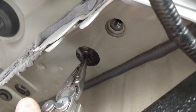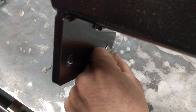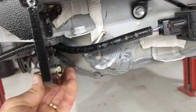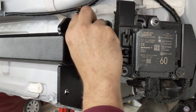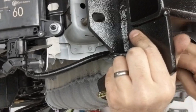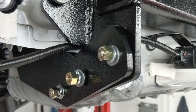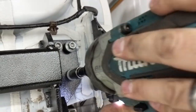Pull out these three thread covers on the frame on the bottom side, then poke the bolt and washer through on the forward-most hole oriented to the outside. Then get a few nuts started — those are the original nuts that came off the bumper — and then put the rest of the bolts and washers on. Just loosely fit for now. Double check that the harness there does not get smashed when it's fully seated, so we're okay to continue.